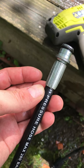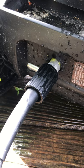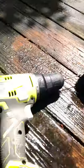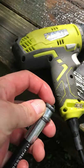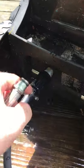So it's giving you that pulsating problem. You also want to take the inlet side and the outlet side and do the same thing on that side. Then you want to run some water through it with the hose to get all those little bits out. Then you want to unplug this and run it through that end once this is off.